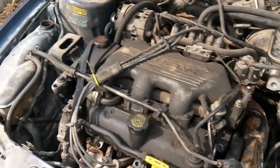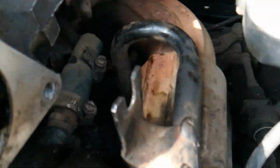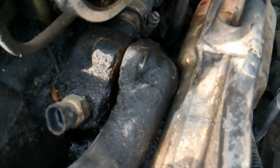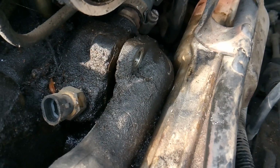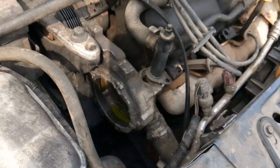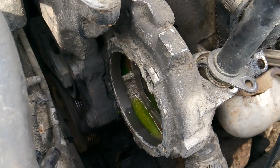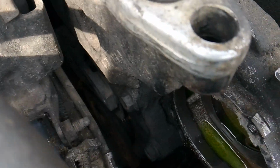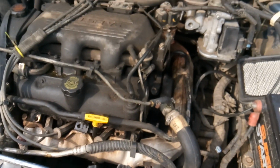And so when I did the pressure test, obviously the thermostat has been leaking for a long time. When I show it to you, you'll agree that, wow, that gasket is pretty much flat and gone. So the thermostat was leaking and the water pump was not spinning, nor was it turning correctly, both because the shaft and the bearings are beginning to go out, and also because the belt tensioner is not working correctly, and nothing on this vehicle was spinning or turning as fast or as hard as it should be.